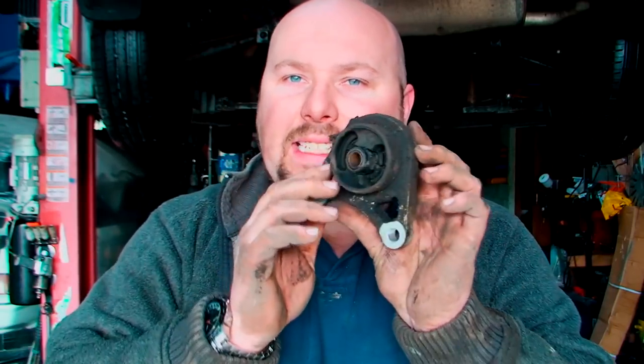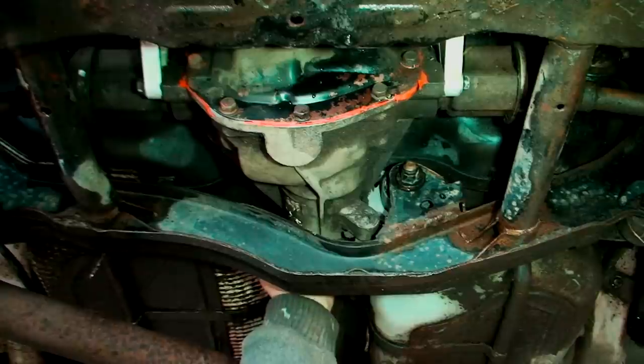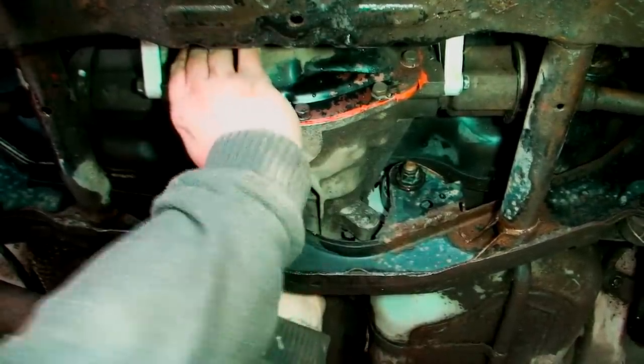To sum up: the front bushing mount has a longer piece and that has to go towards the diff. Keep an eye on all these bushings — they go in only one way. Don't tighten any bolts until they're all in. Be careful when tightening because you're tightening into a cast aluminium block — you can easily snap bolts, round them off, and if you can't see them properly it gets worse. At the start of this video I could completely move the diff and now I cannot move it at all — just a tiny bit from the rubber. That's nice and solid. Sorted.